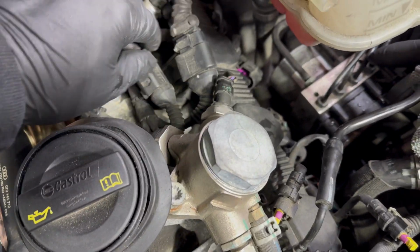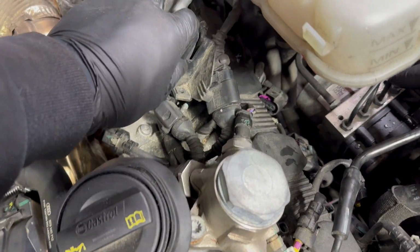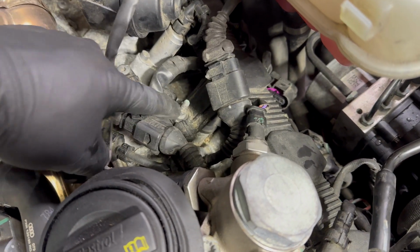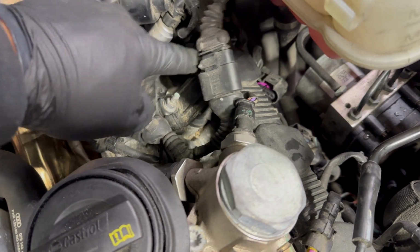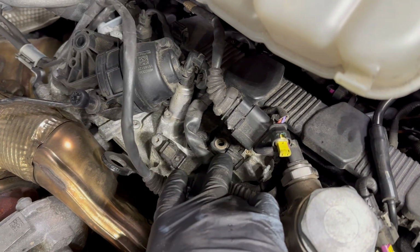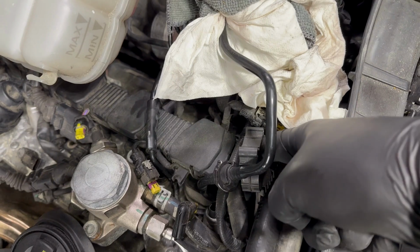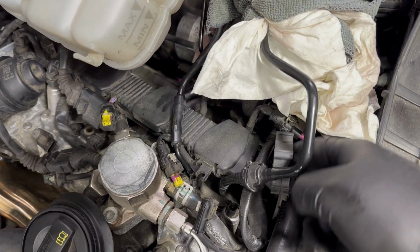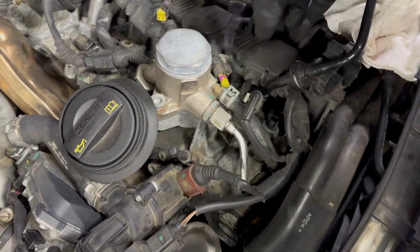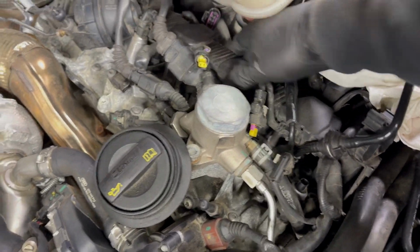and when you take these two harnesses, there's a bracket here, and it's sitting right above this stud. Take this bolt off to take this harness off. This should come up. Once you take that screw holding the bracket down, follow right here, there is another screw down there. It's the same, I think it's a T30. Then you should be able to pull this up, be gentle. That should give you space to get the coils out.